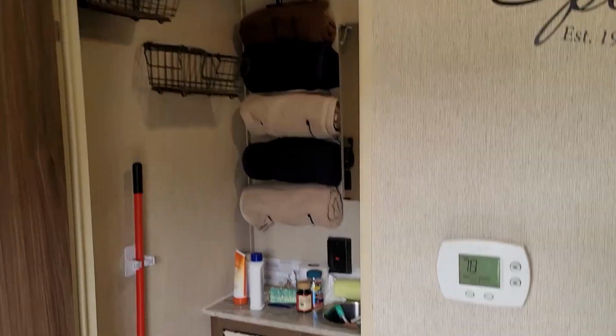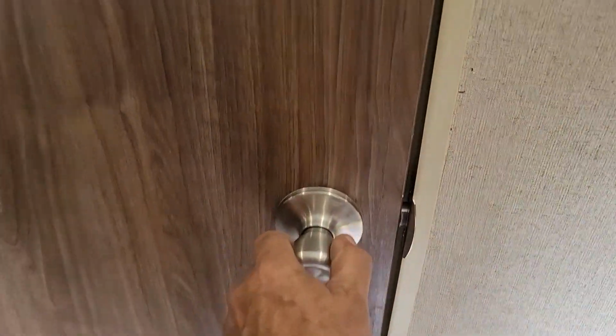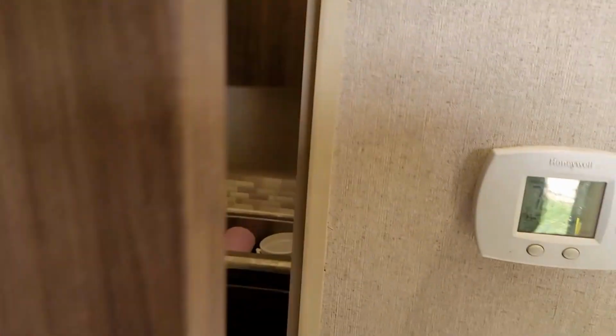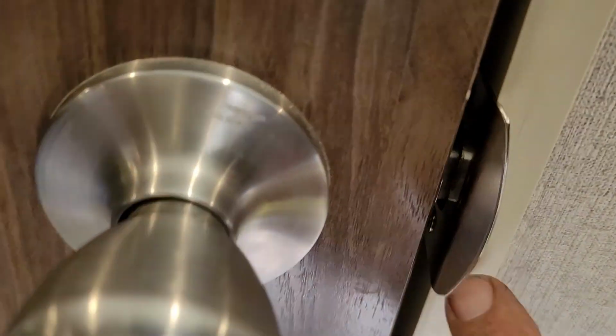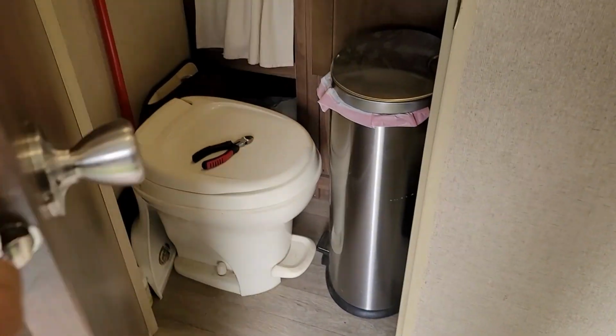And we are back. So got the jamb in, strike plate on, and let me show you. Nice, good solid lock. Now if you kind of look, it kind of varies on the way down, but if I was to just run my hand, because there's a screw here, screw here, I put my hand right there, you'll see that it'll actually move. It's not all the way flush, so actually if I flush that up, that reveal is really nice. A lot better than what it was. Door shuts real nice and easy. We got a good amount of throw on the bolt.